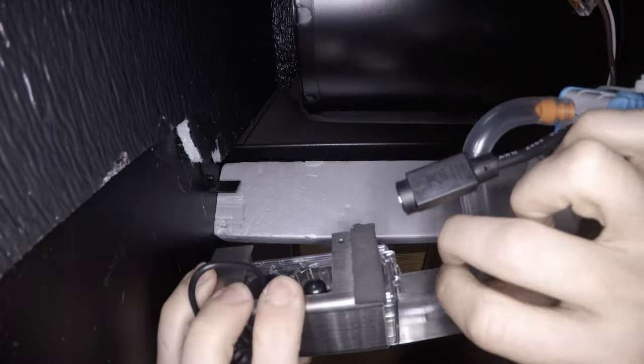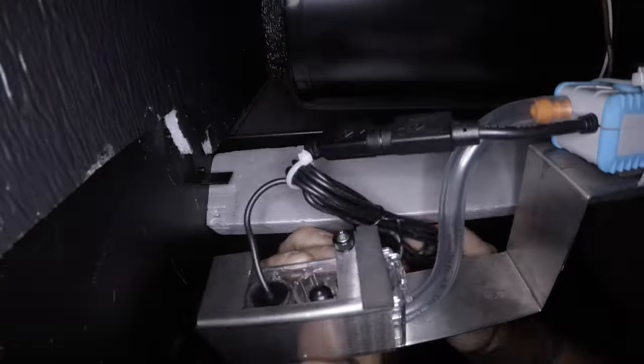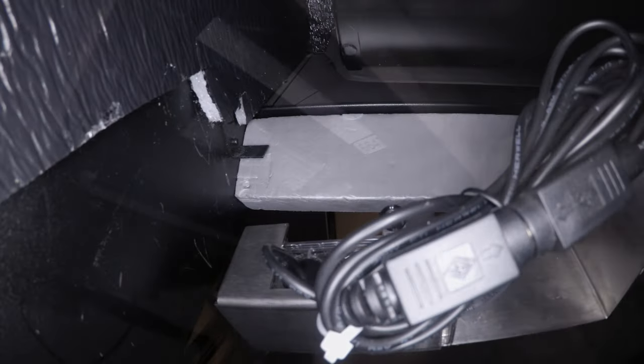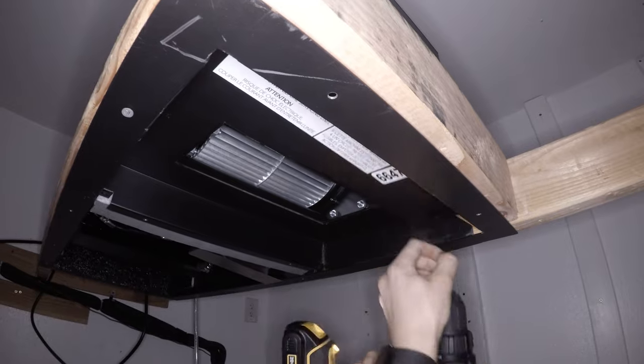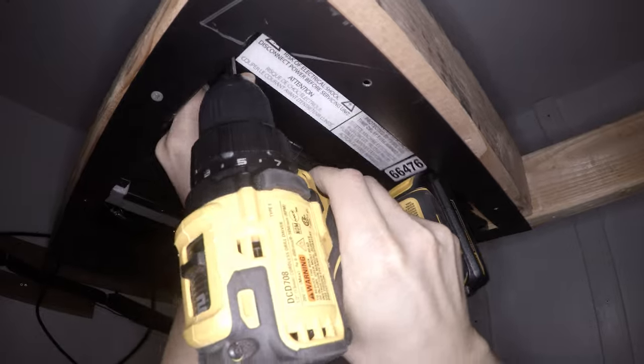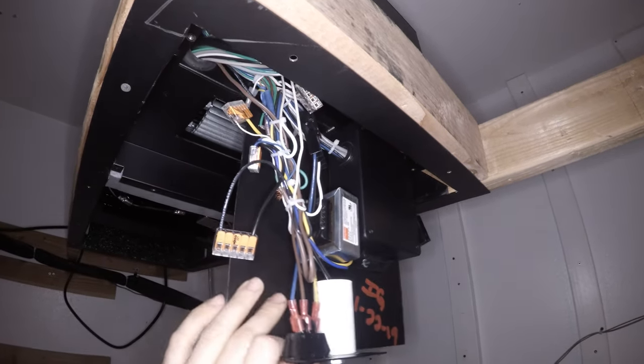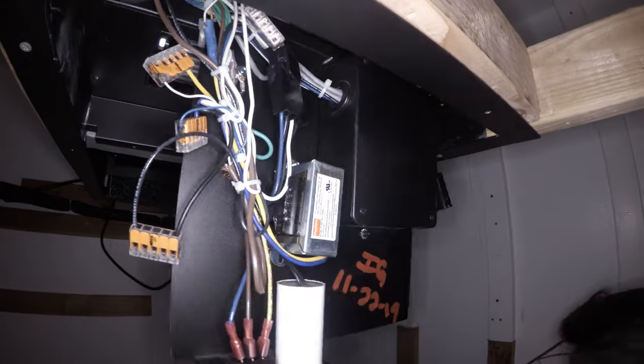Reinstall the reservoir after cleaning. Remove the two screws securing the electrical panel cover in place. Remove the thumb screw and drop down the electrical panel. Remove the electrical box cover.